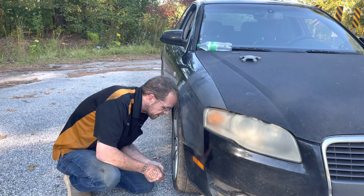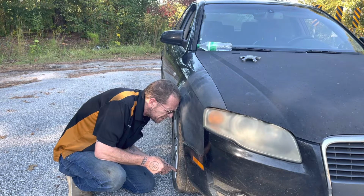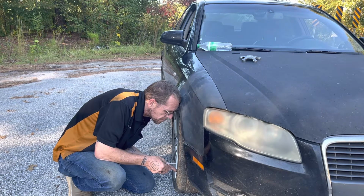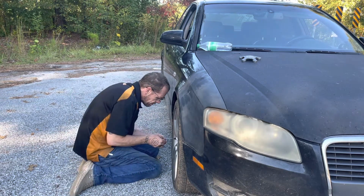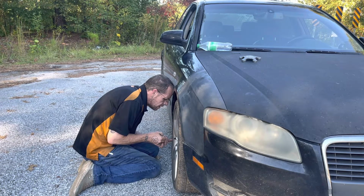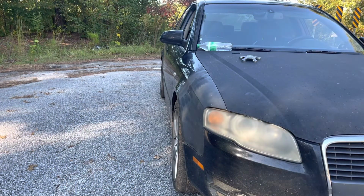So we're at 1 inch, 27/30. Actually, I'm gonna go with the 50ths because it's more accurate. So we're gonna go 1 inch. One inch 8/20. And 2 inch. Jesus. One inch 7/20. 2 inch 1/100. So that does show that my string is straight in relation to both wheels, because I'm exactly 1/100 different from this wheel to that wheel.